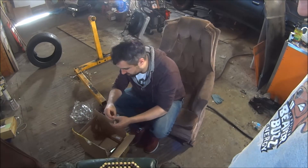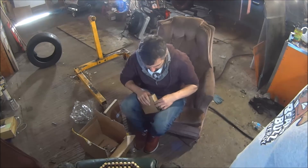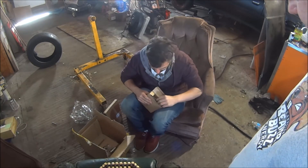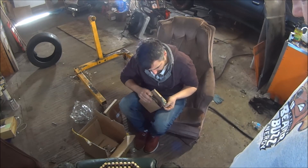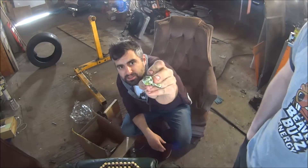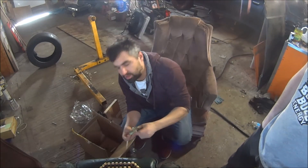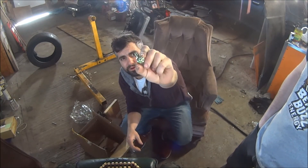But with no washers - so if you don't know what you're doing you're going to mess it up. I'm curious about this one because it's another kit, the same thing, comes just as cheap. This is what you need to look out for, because this will cause turbo failure: the actual port to tee off for oil isn't drilled.